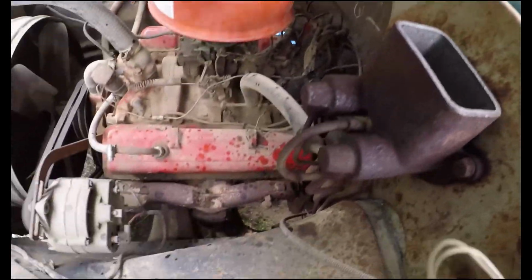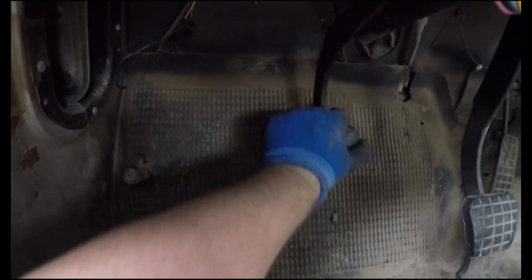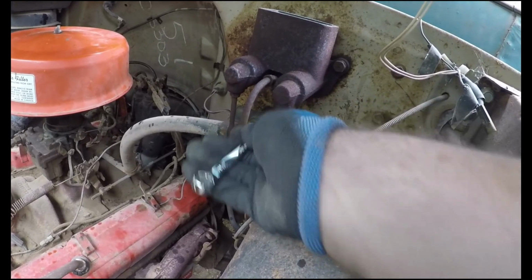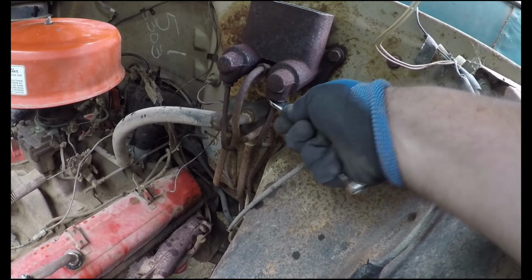Sweet. I put a bucket down there. I'm going to start pumping out the fluid now, hopefully. Fingers crossed. Almost there. Actually splattered everything everywhere, but I've got some brake cleaner to clean all that up, so it's no sweat. So you just keep pumping through. The pedal's on the floor now. I don't know if you can hear that. The ports on this one are a 7/16. A bit of fluid's going to go everywhere in a sec.